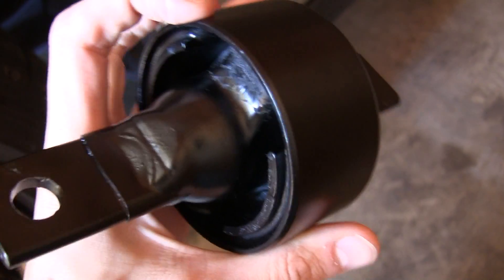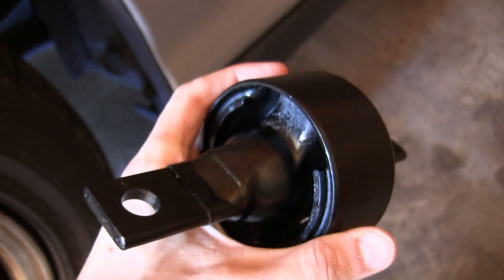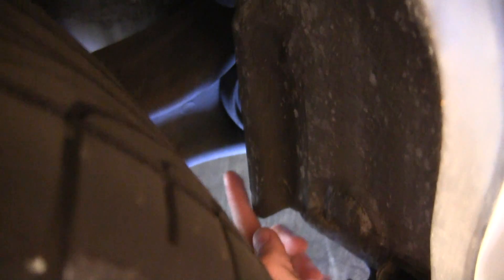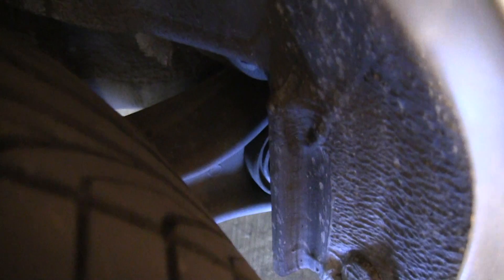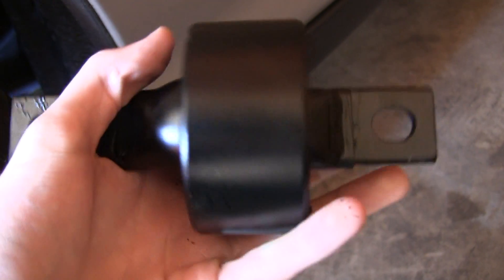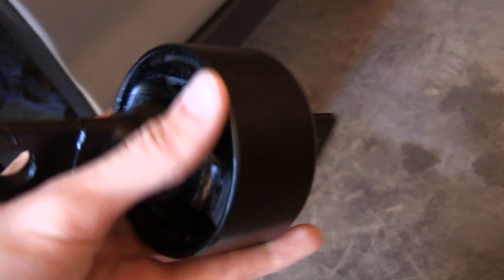In this video we're going to be replacing the rear trailing arm bushings of a 1999 GS Acura Integra. This is the part we're going to be sticking in — I got this off Amazon for about 25 bucks. It goes in the rear trailing arm. There's a bushing in there where the trailing arm pivots, and the rubber over the past 15 years has started to deteriorate and degrade, so we're going to replace it. What we've got currently is basically a destroyed bushing.